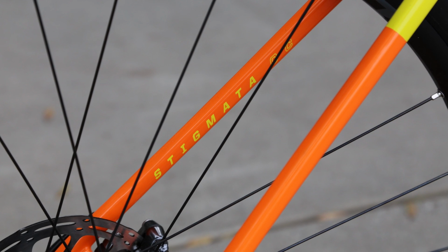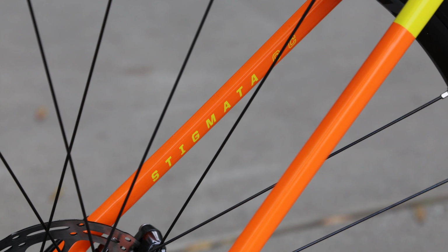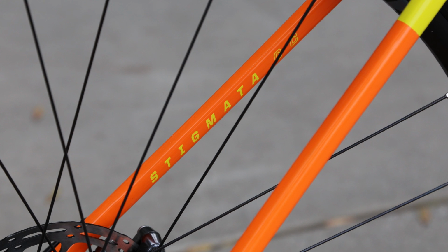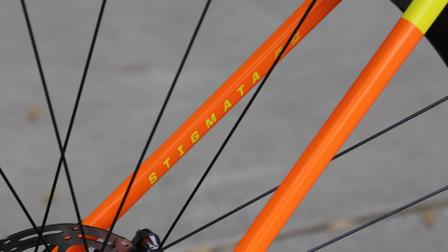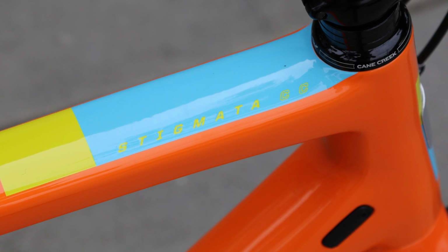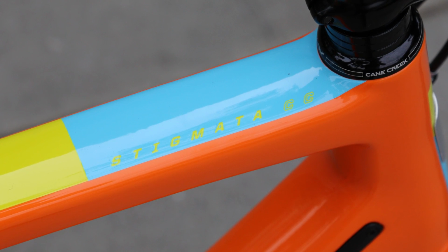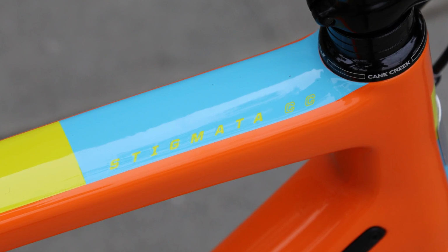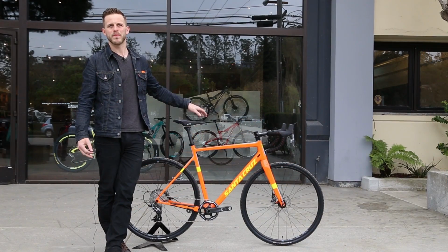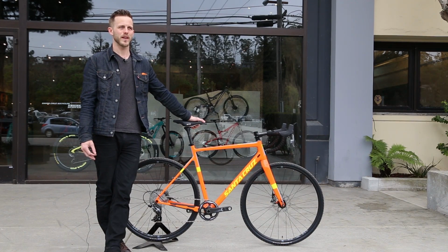So we started working on it, and I think for us the starting point really was making a bike that was a cyclocross bike. We started with a classic cyclocross geometry, but like the new version of what is now a classic cyclocross geometry. A lot of the older cyclocross bikes had really high BBs. I think that's a legacy from when people were riding with toe clips. You would see these ridiculously high BBs because when your toe clips were flipped upside down when you were remounting, they would drag on the ground. So, BB drops in the 50 to 55 range.